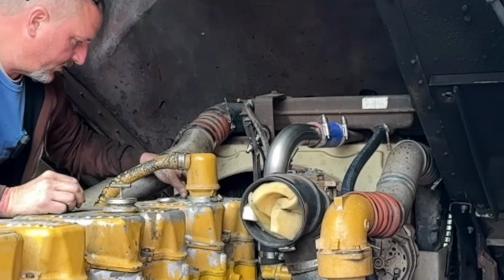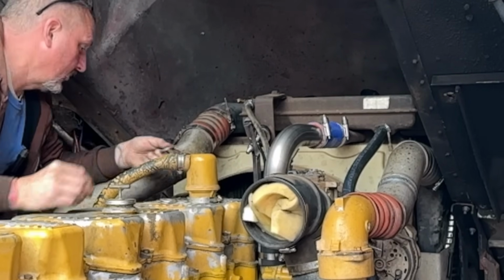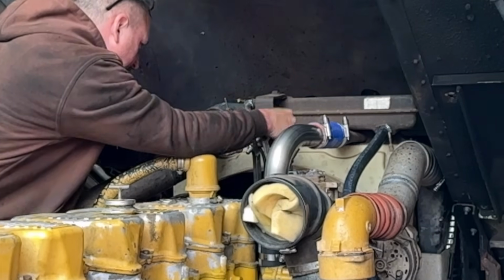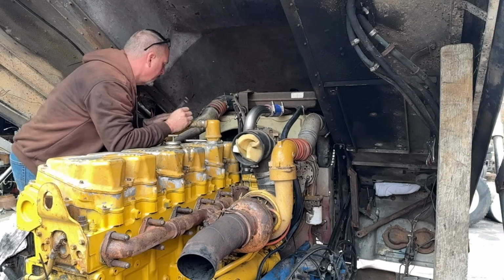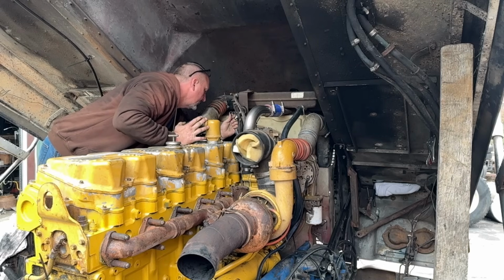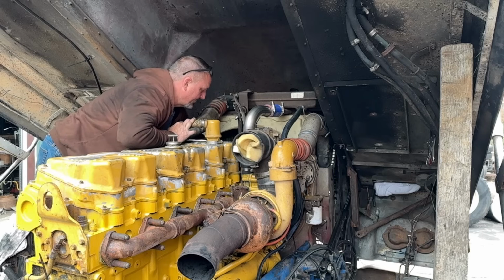Okay, I got to get another bolt, and I think we're going to use another washer just for kicks. I probably should use another washer on this side, but it's all right. So hopefully you saw some of that, but what we're doing right now is tightening up some of these bolts. Oh, it's not 3/4, it's 11/16. So I'm going to tighten this. This is a grade 8 in here, and we're going to tighten it up.